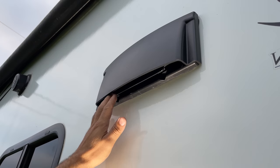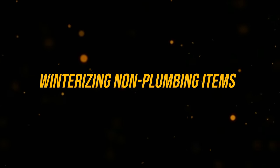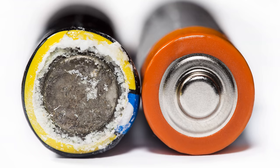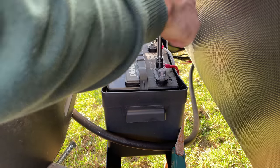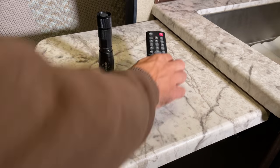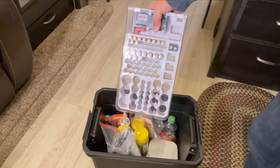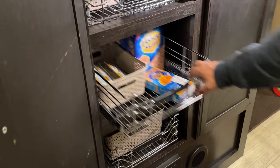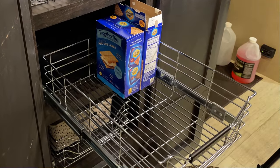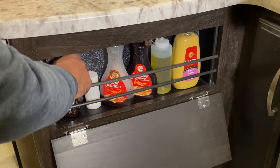The plumbing is now complete, but let's talk about some other things you should be considering when winterizing that don't have to do with the plumbing. Cold temperatures can damage batteries and cause them to crack open. Remove all batteries from your RV — that includes the 12-volt DC battery up front that runs all your DC powered components, along with all the small batteries in smoke detectors, remote controls, flashlights, power tool batteries, and anything else that is battery powered. If you keep an inventory of extra batteries in your RV, remove those as well. Remove all food and drink items from your camper over the winter — don't forget the salt, pepper, spices, cooking oils, and all those things. You don't want to give animals or insects any reason to come into your RV over the winter.